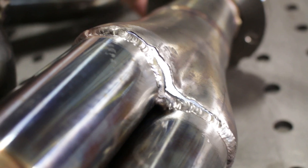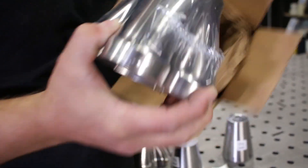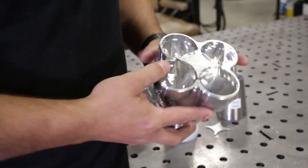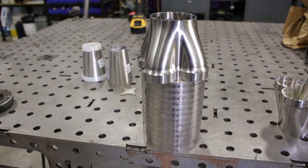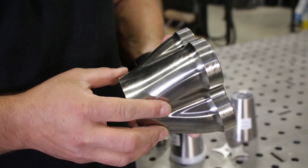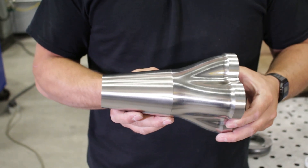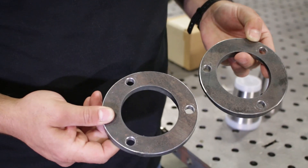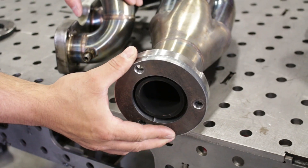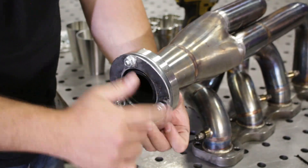I don't know how you would have fixed these — they are very challenging to fix. I was very stressed about this, that was until I remembered that my friend Shear Fab makes the nicest billet collectors. These are machined from solid stainless steel blocks, they are much stronger and they should slip onto this collector. I've got these manifolds back in my shop and we are going to jig these things up to the table and see if we can retrofit these billet collectors into place and save this set of manifolds.